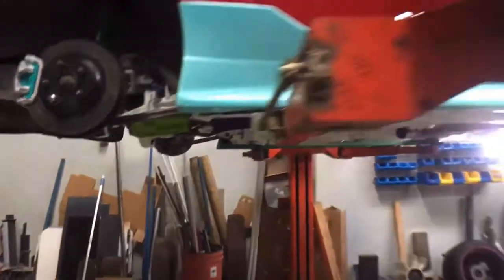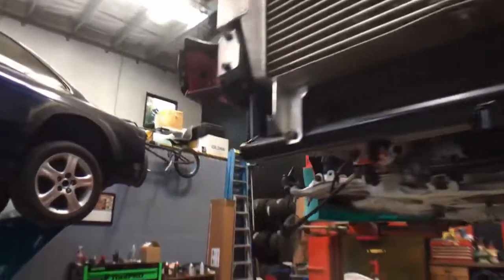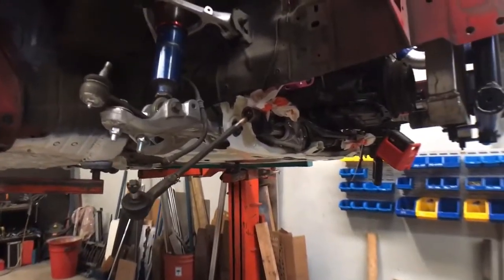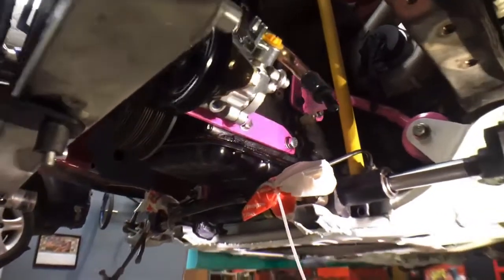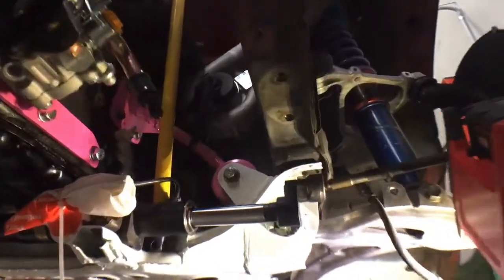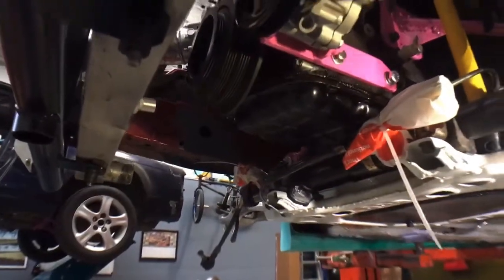And then once I get the exhaust blocked up and done, I can pull the engine out and start sanding the engine bay. We're done for that sort of mounting of stuff. But yeah. Anyway, I'll just make this video the power steering pump video. That thing's all done. It's nice and low. Oops. The turbo's up there. And I wanted to have the intake pipe coming off the front of the turbo and running above the power steering pump, so that's why it's down nice and low. Also it makes it less ugly up in the engine bay.